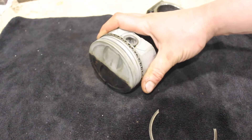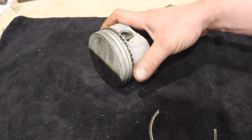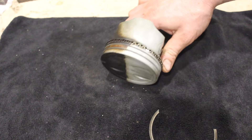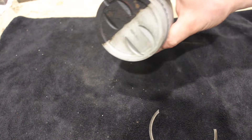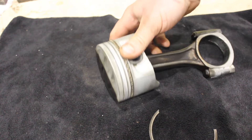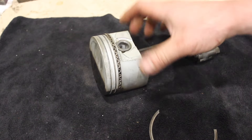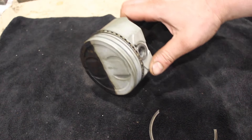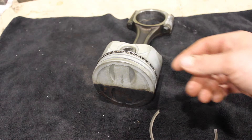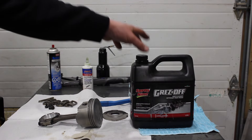It's just nice because you can throw stuff in and let it soak. You can also dilute it — I've diluted it sometimes up to 50/50 with water and it still works pretty good, though obviously not as fast as at full strength. When I soaked this piston it was basically at full strength, so it worked really fast. Like I said, it looked like that after about an eight-hour period — probably less if I had just scrubbed it a little with a nylon brush. Pretty impressive for an at-home way of cleaning pistons without anything too nasty.